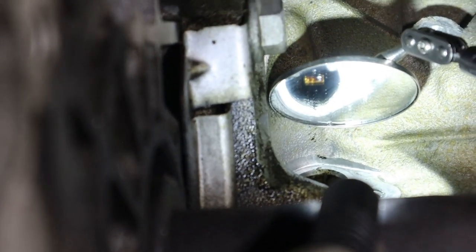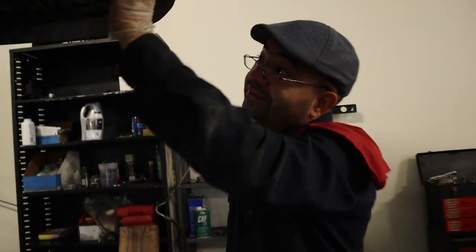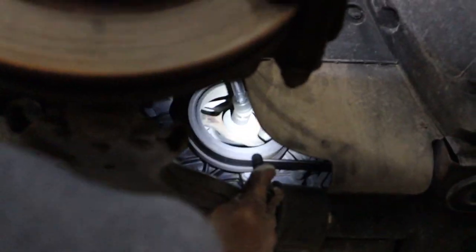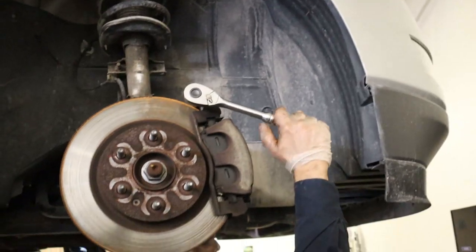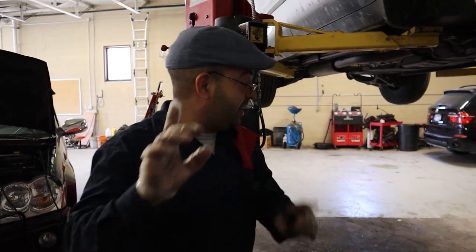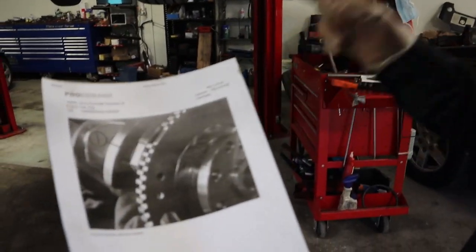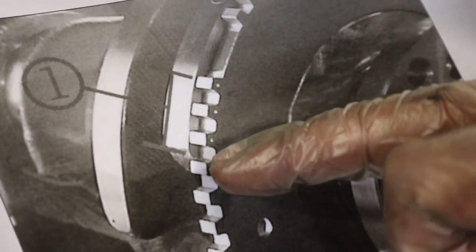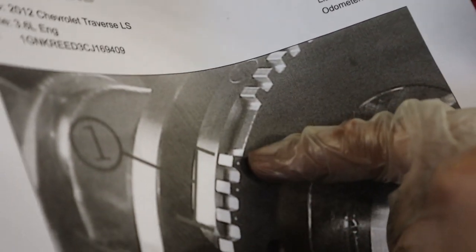Once you're watching through there, it's going to be a two-person job, because you need somebody to be turning the harmonic balancer bolt so that the whole crankshaft turns. You'll do it through here. We've got the setup right here — it's a 19 millimeter, get a nice long extension and put your ratchet right here and it just turns easy. So remember, it's going to be three and a half teeth — one, two, three and a half — from the actual crankshaft to the beginning of the gap.